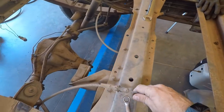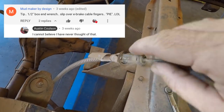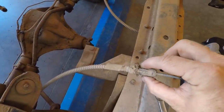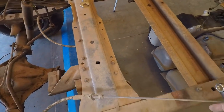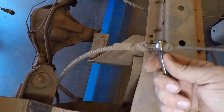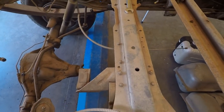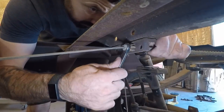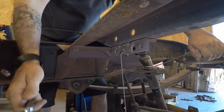Here's a nice little trick somebody pointed out to me. This is the parking brake line. Normally I'd use 90-degree pliers to pry the three little tabs in and push it out. Somebody mentioned you can use an open-end wrench — in this case a 9/16ths. You see how it fits around it perfectly. As you slide it on, those three little tabs squeeze in and you can just push it right out. Way easier.